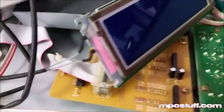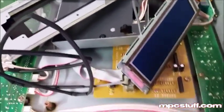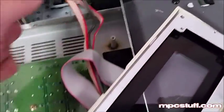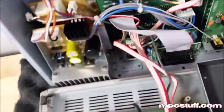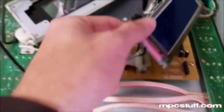I'm going to show you the back side. We cut off the other connector. Right now we have this wire here that was the original supply for the backlight, and that's going to be replaced with this new one. The next thing we're going to do is get this back in and fish this wire back through to replace this one. The old one goes up here around here and then up to where it's powered. This is going to come out completely and we're going to take our new backlight and use this connector to put in there instead, getting rid of this old wire. It comes with zip ties, so you'll need to cut some of the existing zip ties off to get the wire loose, but new zip ties are included. We're going to put this back into the LCD housing, fish the black wire through it, and get that going.